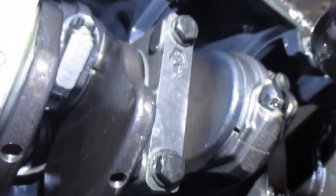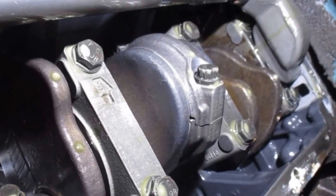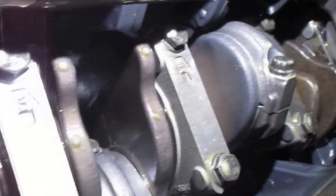This is the underside of the engine without the pan. Right here — there's the rear main, kind of cool. Otherwise everything almost looks the same. I'm not really seeing anything particular defining anything just yet, but once I get the coolant pressure tester back on this again, we should be able to pinpoint it. There's a pickup screen there — doesn't look bad, just a little milky crap. That is what we've got.